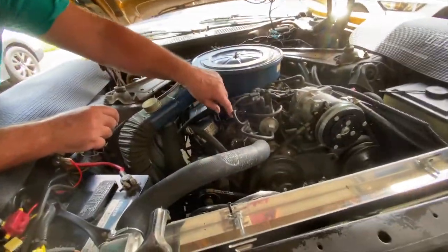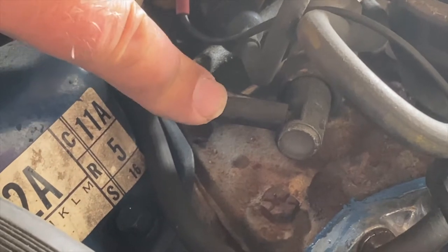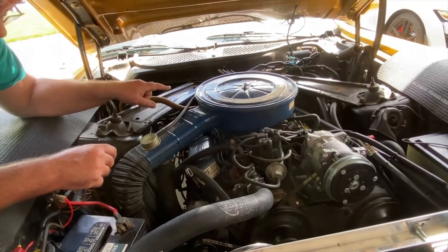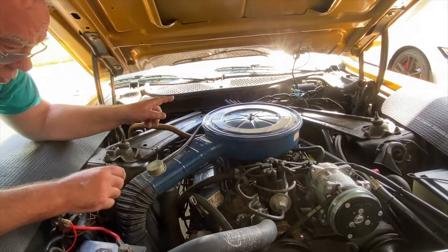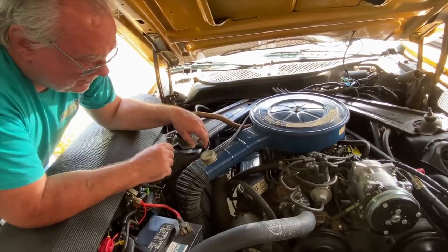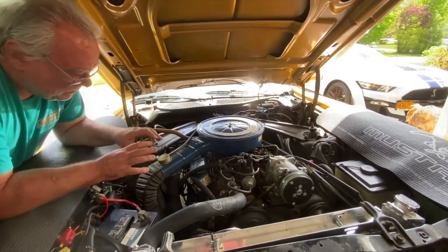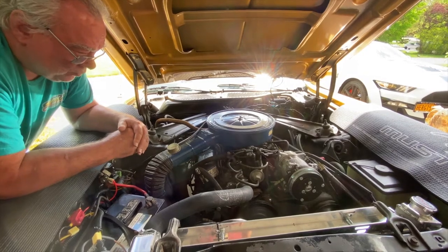The other switch we have is a small two-port thermal vacuum switch. One end connects to the exhaust gas recirculation valve and to a four-port T that provides supplemental vacuum to a dual diaphragm vacuum advance modulator. The other port on the two-port system goes to the carburetor ported vacuum. So I'll take all this apart and then we'll go through these systems, showing the difference between manifold vacuum and ported vacuum.